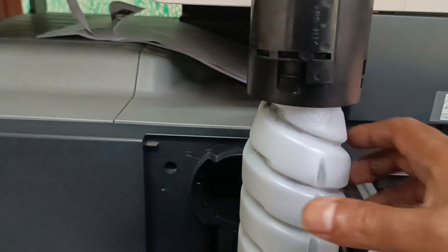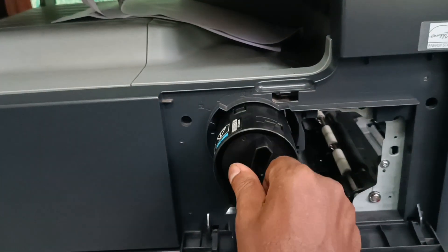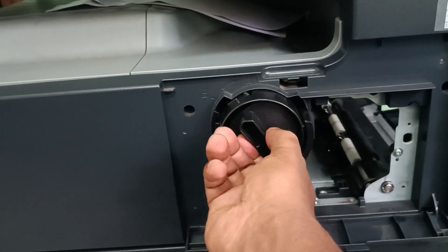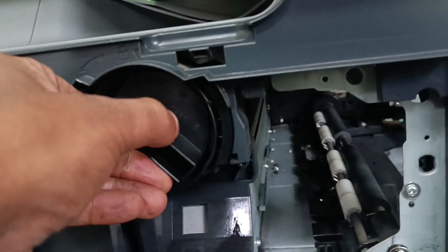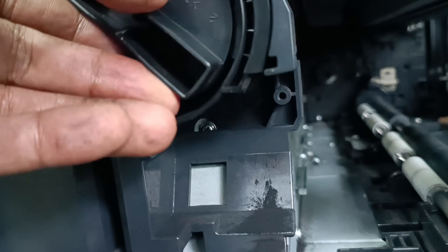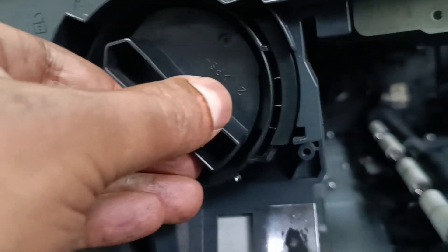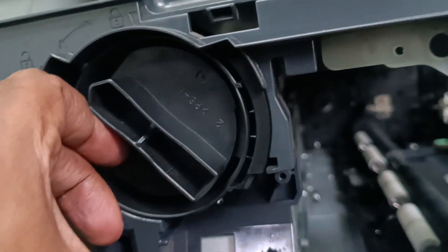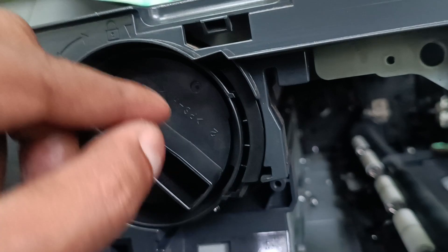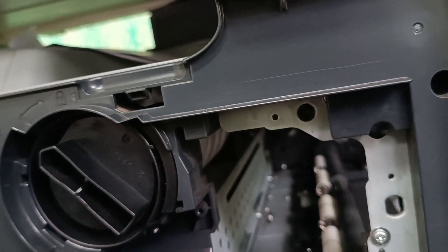I will explain to you how it works while you are putting the cartridge into the machine. While you put the cartridge inside, it goes in and you can see that some toner is already present. When you move the lock in the clockwise direction, this area will automatically open and connect to the developing unit, then the toner gradually moves from the toner cartridge into the developing unit.